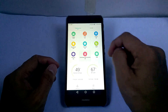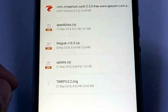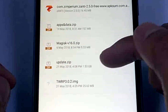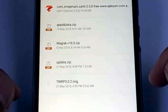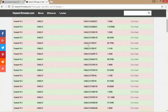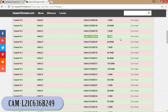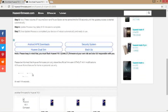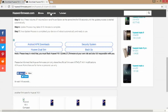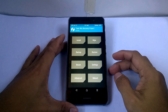I'll show you my downloaded files. I have a backup of apps and data, Magisk Manager for root access, and of course the new version of the update firmware. You can also use the most latest update firmware if you want — go to the site and choose the version of firmware. For this time I chose C636B249. Click download, scroll down, click the download link, wait for the timer, and when it's done click download. You're ready to go. Let's flash the downloaded version of firmware.